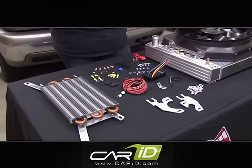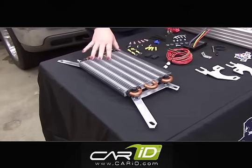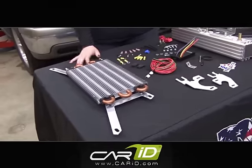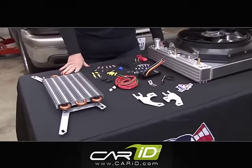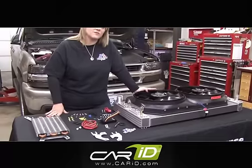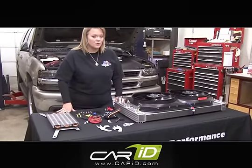This application has an automatic transmission, and there is not a cooler included in the side tank, so we also have an optional transmission oil cooler, which is part number 4118 GMT, with brackets specifically for this application. The part number for the radiator and fan combination is 57291. You can also get just the radiator, which would be a 57001.